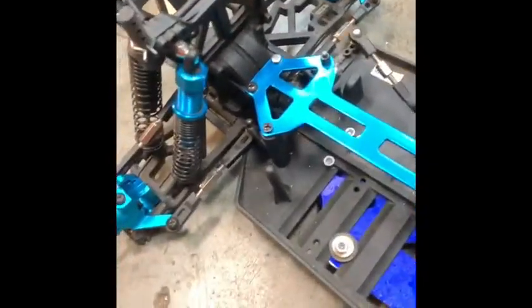How short it actually is compared to the engine — I thought it would be long enough but I wish it was a little bit longer. I mean it's a smaller RC car, so that's a really big engine. Look at the scale difference. I lengthened it quite a bit though. What I'm gonna end up doing is taking a driveshaft going from the engine, from the clutch right there, going from here to here with another gear — I think I'm gonna have to put it on an angle. I'm gonna have to put like two or three shocks in each control arm, and I'm probably gonna end up doubling up the springs on each shock in the front and leaving the backs the way they are, because this thing is gonna be heavy as crap, and then I'm gonna have to make like a lighter wheelbase.